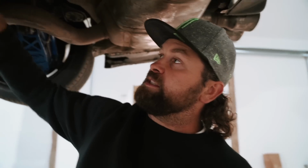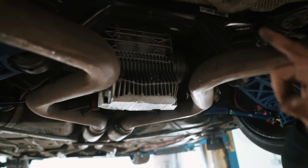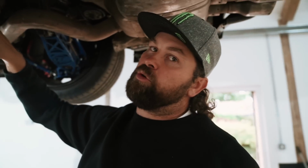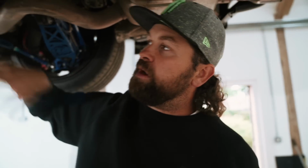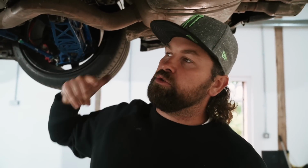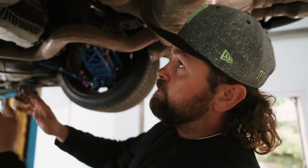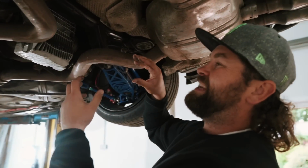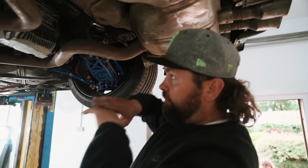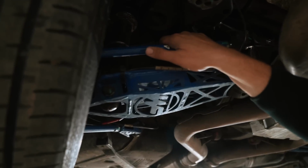And then in the center, we've got the new Hack Engineering or BMW Motorsport 4.4 ratio crown wheel and pinion differential, basically a refurbished diff, with a modified rear cover and a bigger crown wheel and pinion to lower the final drive so we can pull third gear drifts, which has worked perfectly. So yeah, new diff, new subframe, all new bushes in the subframe mounted to the chassis, all new bushes in the diff mounted to the subframe, and then moving out from there, as you can clearly see, Wisefab rear suspension